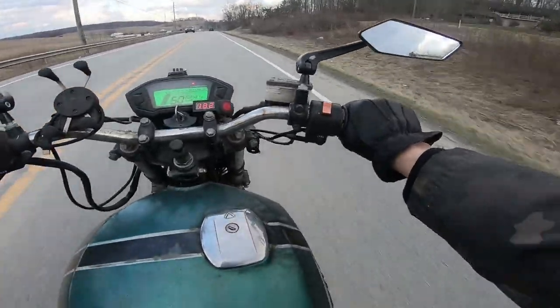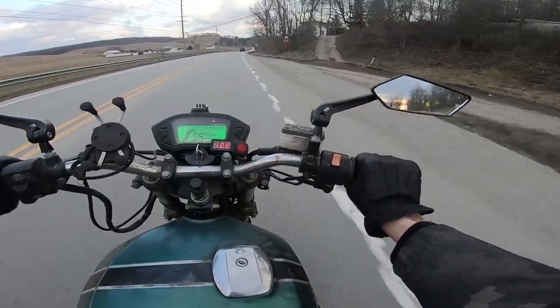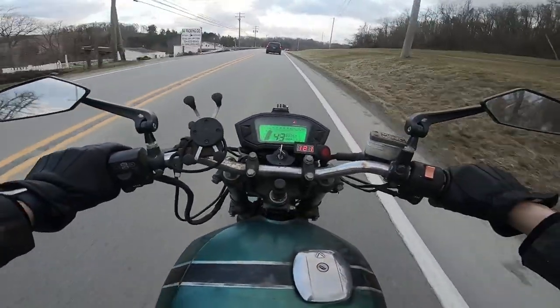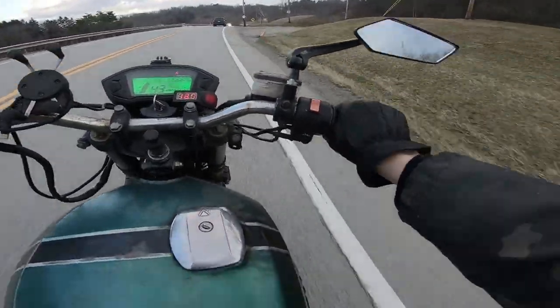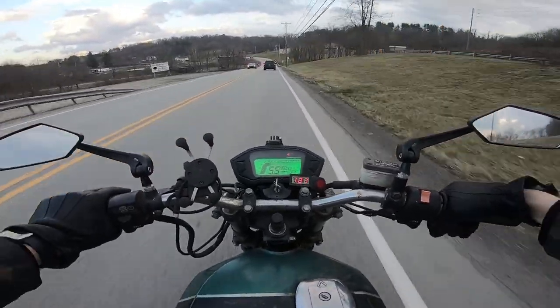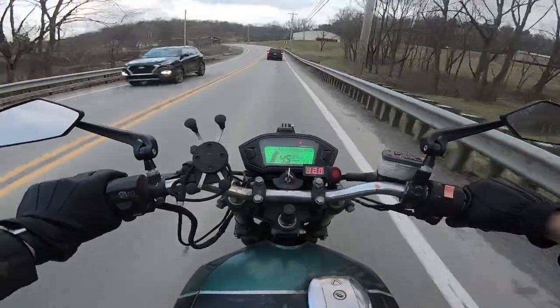I filled it up with gas, and the bog is definitely less. I think the bike's definitely running better with the three washers as opposed to the one that was in before, but it still has a bog in mid-range. I am now thinking that this bike has a vacuum leak, so I'll look into that in the next video.